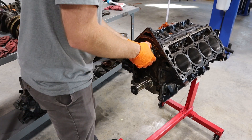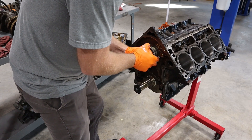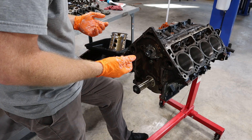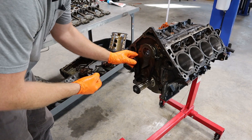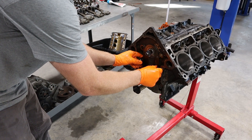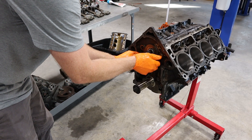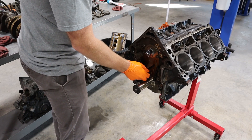This last little bit's going to be a tricky one. Got to tilt the back of the camshaft up enough. All right, let's get that faceplate on there. This plate does two things: one, it holds the cam in place, and two, it serves as a tensioner for the timing chain. These bolts get tightened to 21 foot-pounds.